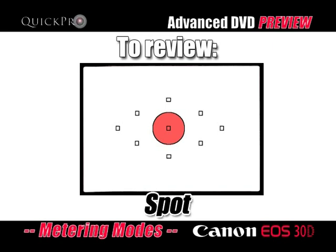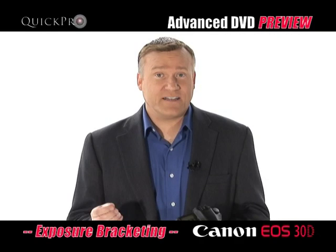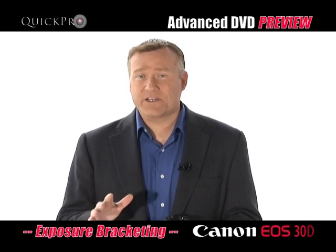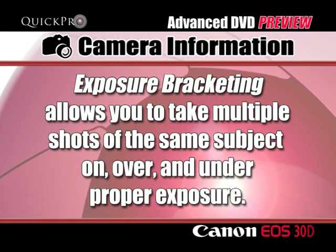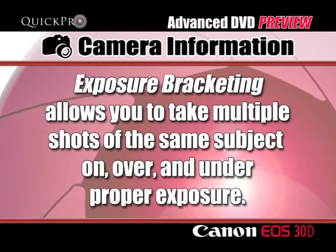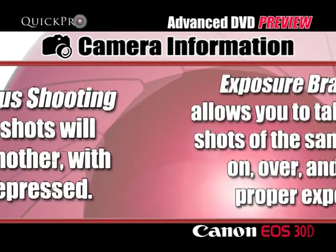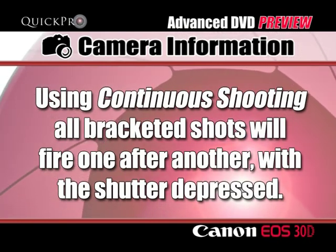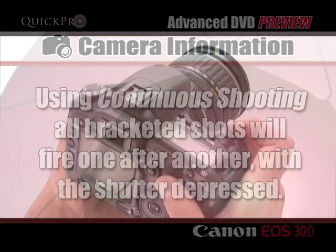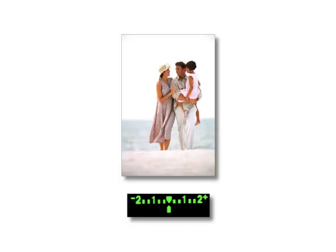The last advanced feature that we'll preview in this DVD is the Auto Exposure Bracketing feature, or AEB feature. Exposure bracketing allows you to take one photo at the proper exposure, another at a higher exposure, and a third at a lower exposure, thus ensuring that you will have properly exposed your shot. Depending on the drive mode that you've selected, such as high-speed continuous shooting, you need only to press the shutter once to have all three shots fired off.